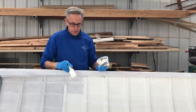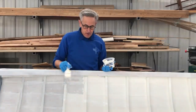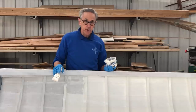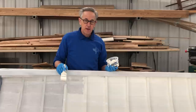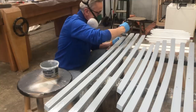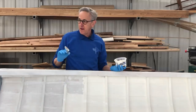Right now I'm just putting the first coat of the topside paint on, mainly so that I can keep the inside of the hull a little cleaner when I'm working in there. Being an enamel base and having a little sheen to it will help do that. So as you can see, I've got all of the parts and the bilge painted, and now what we'll need